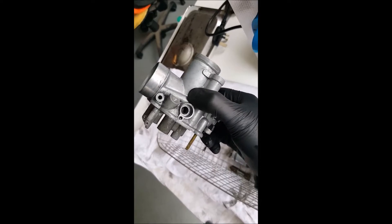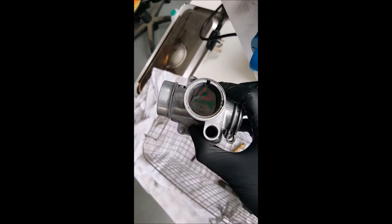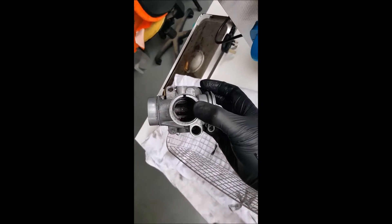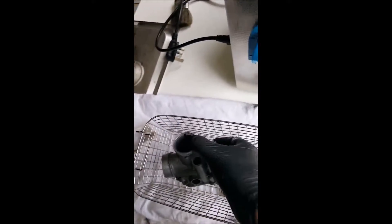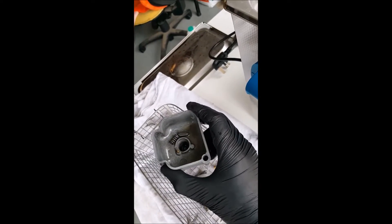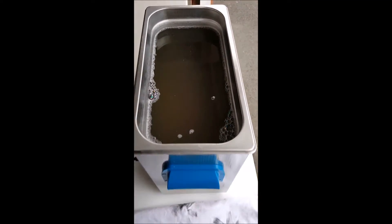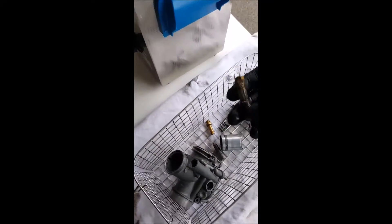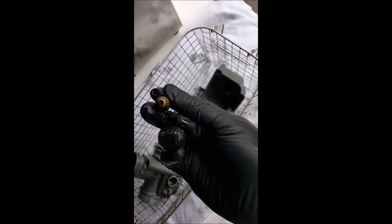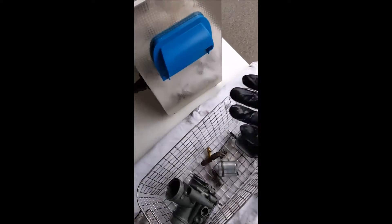Well, it's not exactly like new. I would say it's probably cleaner — I imagine it's probably cleaner inside — but on visual inspection, I was hoping for more, if I'm honest. This float bowl had a lot of grime baked onto the bottom. Yeah, it's definitely cleaner, but it's not brilliant. Looking at the amount of muck in the water, I don't know whether the cleaner has reached saturation point, or whether it needs longer. This is a main jet in brass — it's not really substantially cleaner, I've got to say. I might let the whole lot cool down and give it another go. Yeah, that's what I'm going to do.